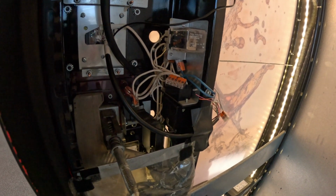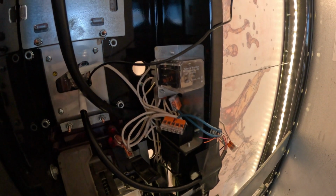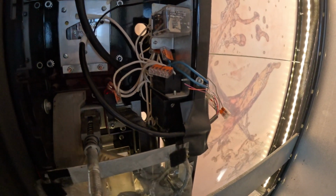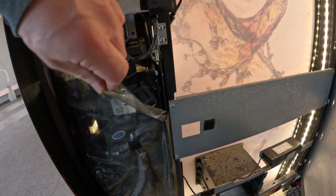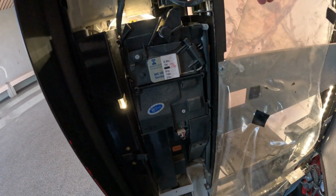To make this work, you need a card reader, a pulse cable for the reader, a pulse relay board, and a separate power supply for the card reader. Make sure the pulse relay board matches the same voltage as your card reader. That's important to avoid damage and make sure everything runs smoothly.